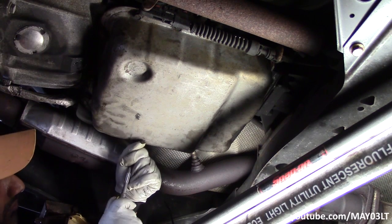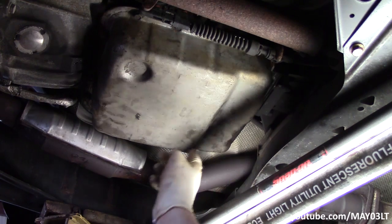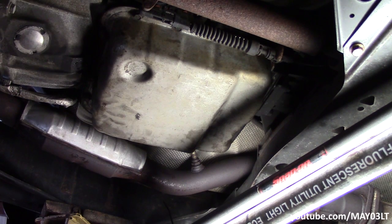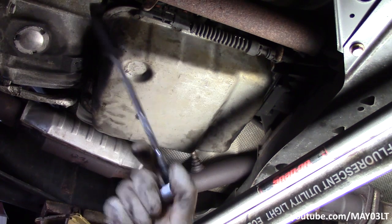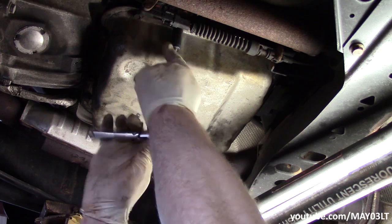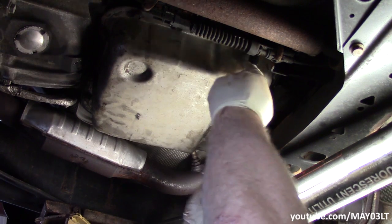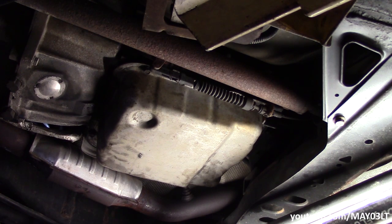When I'm doing the final pass for tightening these up, the way I personally do it — I don't follow any book or procedure — I just go every other bolt and then come back around and do every other bolt inverted. Just go around snug with a little tiny ratchet, every other bolt. It's worth the extra time just to make sure all 16 bolts are tight.